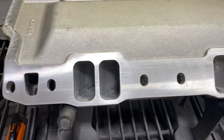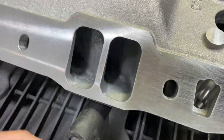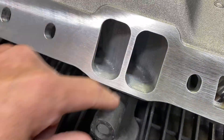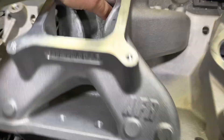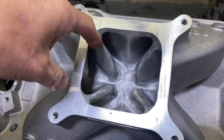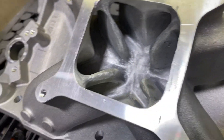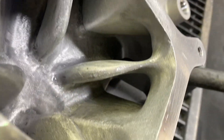Just got done porting the intake. This is the AFR intake, like one inch in, and it's been machined to a 1206 gasket. On top, I took it and cut out the clover because I plan on using a nitrous plate — trimmed that out. Got in there and made everything look a little bitchin'. It's all my hand work, nothing professional.